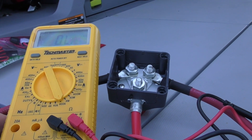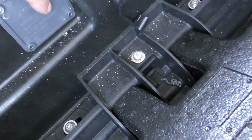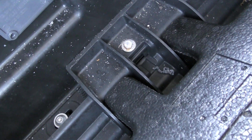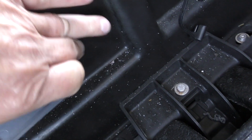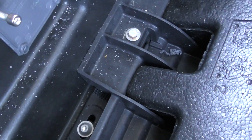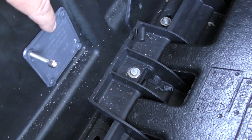Here's the end of my switch on the inside, which I'll show you in a minute. I placed my plate and drilled the first hole, so I'm going to use that as a template and drill the other holes. I'm going to go from this side to the inside because it's a lot easier to get to. There's my plate — I secured one hole and I'm going to drill the other three holes.